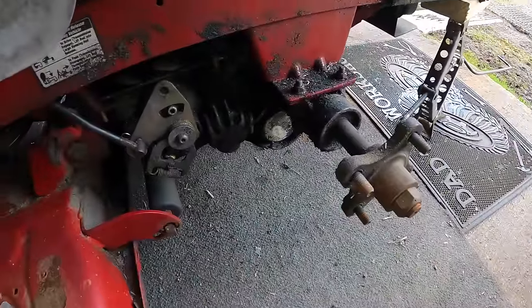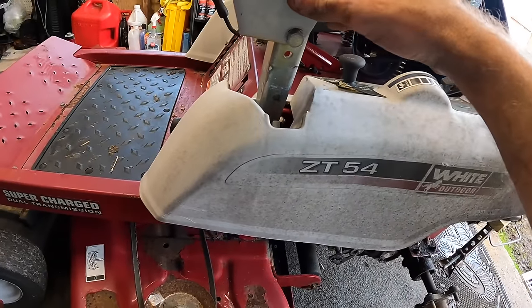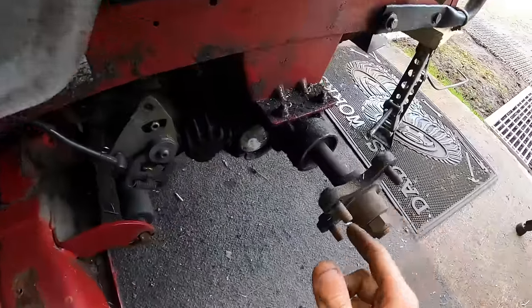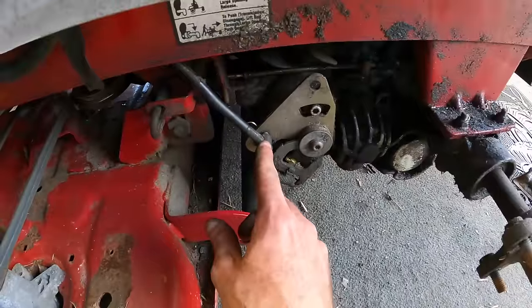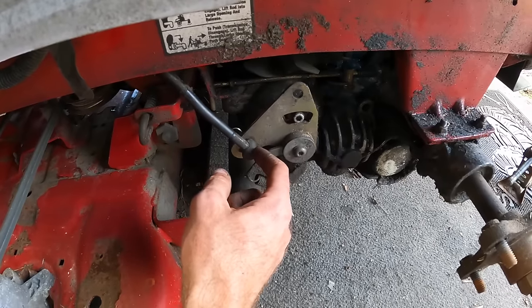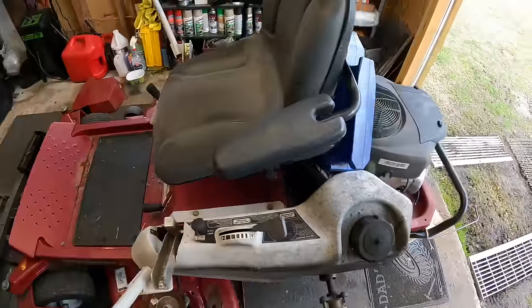I'm not sure how long it was into that where the GoPro battery died, but the issue I was having is basically I was trying to get it set, but every time I put it actually in the groove it needs to sit in to be on the safety switch, I couldn't get it to sit right in the neutral position. So what I ended up having to do was to rotate the little end here on the rod that comes off from the hand control and get that adjusted. I'll show y'all, but I just had to go between the two,